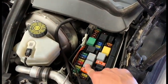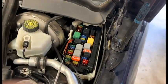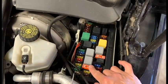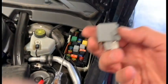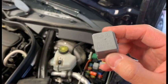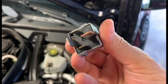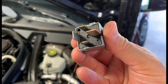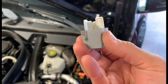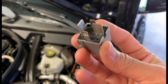Notice all the different relays. I'll also tell you how to jump a relay. So when you pull these up, here's a relay. On the bottom there's numbers by the terminals — this one says 1, 3, 2, and 5. Based on the size of the terminal, it's easy to tell which is the control side and which is the power side.